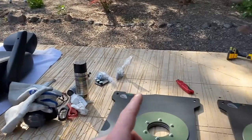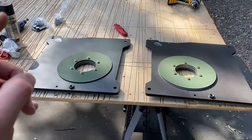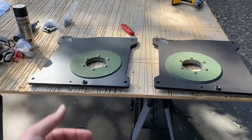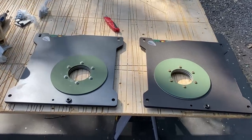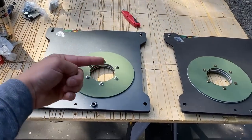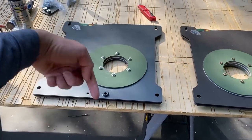While that paint is drying we now need to put the seat swivel onto the seat base in the van. They actually both fit on either side — you just have to flip them up and rotate them into the correct position. Make sure that the little hole is towards the inside of the van, and the bolt hole for the switch is towards the back of the van.